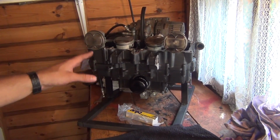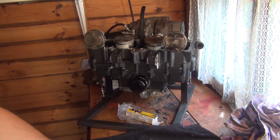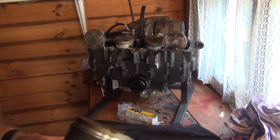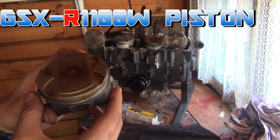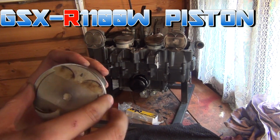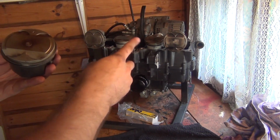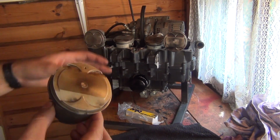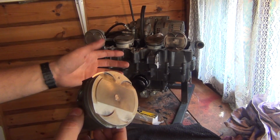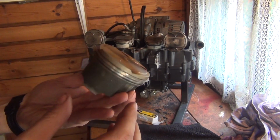Right folks, so I'm just about to start installing the cylinders with my decompression plate, or spacer plate if you will. Here I've got my spare piston with some rings on it, and I just wanted to show you how the service manual instructs to install the rings. Those rings are moving on those pistons, and therefore once the cylinders are out, it's a good idea to maybe readjust those rings to the settings that the service manual recommends.